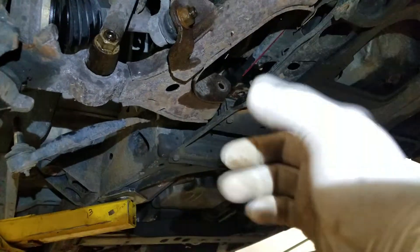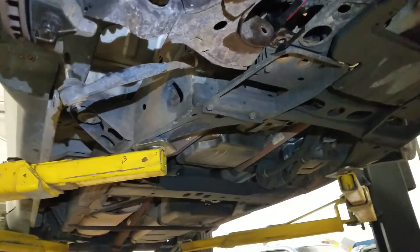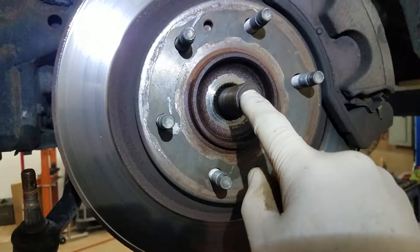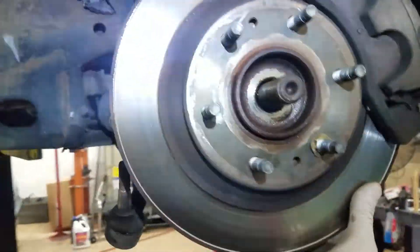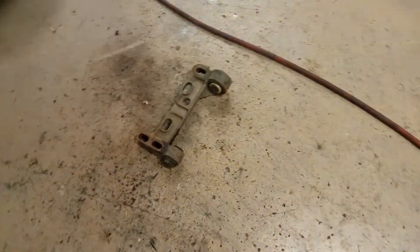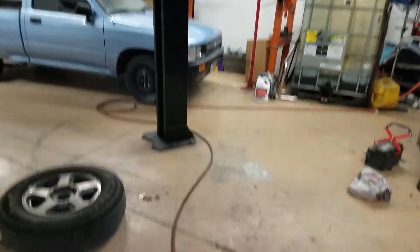Because it's so flexible and you've got plenty of room to do it. The only thing you have to do is the nut for the CV axle, spray some lubricant so you can push it back and forth, and loosen the outer tie rod because you want some flexibility. And that's it. The piece is out. Just work it out, take it out, boom.